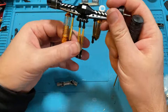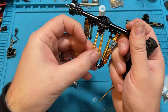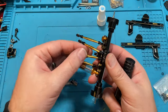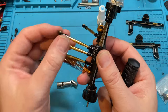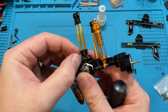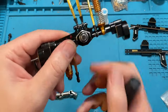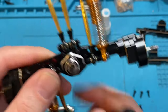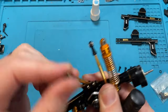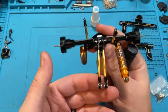Here we go. You want to make sure everything's as loose as possible. Our uppers feel a little stiff here. You can always remove an O-ring if things are too stiff for your liking. This isn't meant to be a crazy, crazy competitive rig, so I think we're plenty loose here. We're good. Like I said, these uppers could be maybe adjusted a little. Oh, it looks like we're rubbing just a little bit, actually, is what's causing it. A little bit of rubbing there. That's okay. That'll break in over time. It's actually breaking in as I do it right now. It's just barely rubbing on the clear or the powder coat. But yeah, we should be good. Oh yeah, that's way better now.